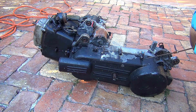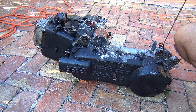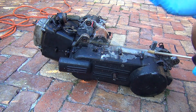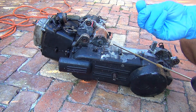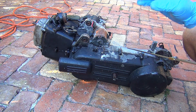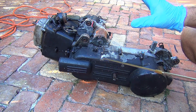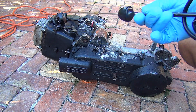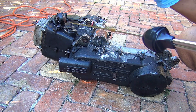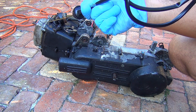Going toward the back you have the clutch — pointing back here you're going to listen to the clutch. Don't go too far back because in the back you have the gearbox where all the gears are. If you have grinding gears making noise back there the stethoscope will reveal it, though this usually doesn't happen if you keep gear oil in your gearbox. If you take care of maintenance — gear oil and motor oil — you should not have noise from your motor. The most important thing is usually the valve clearance, which you need to perform every 3,000 to 5,000 miles.